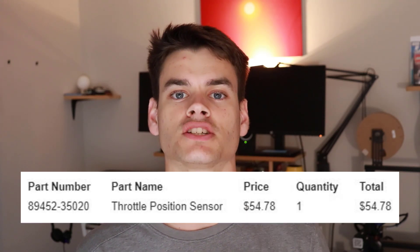If there is a fault in this sensor — say it's supposed to be sending 3 volts to the ECU, and for some reason it drops down and only sends 2.5 — there is going to be less fuel, and your engine is going to sputter, and you will feel that as you are driving down the road. If this has happened to you and your check engine light has come on, I would thoroughly recommend going to an AutoZone, O'Reilly, or Advanced Auto Parts — somewhere they will pull the code for you, see if it is in fact the throttle position sensor, and go ahead and pick up a new one. They aren't super expensive, and it's going to help your engine smooth out again.